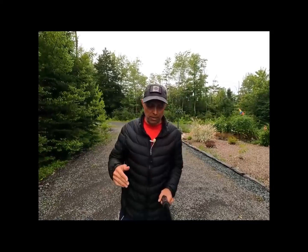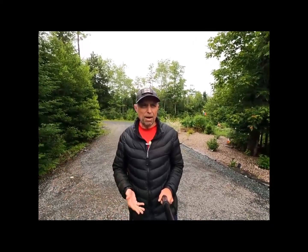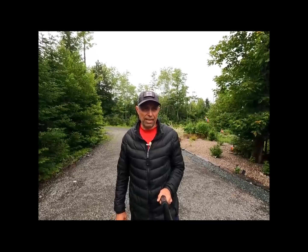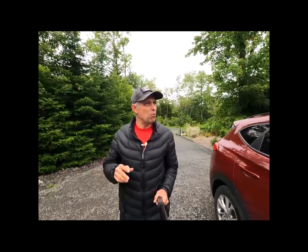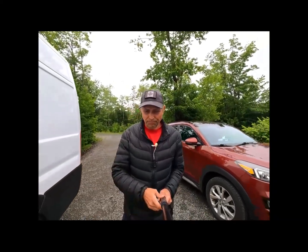And what I did was I went and checked in my van, and sure enough, there was condensation buildup in the windows, the windshield, and the side windows. However, underneath my flooring, when I checked, there wasn't any condensation buildup. And that's because I was using an electrical heater to pump dry air in my van to reduce the possibility of condensation buildup. Now, today, it's been raining for a couple of days, and the humidity is really, really high. I'm going to show you the difference here.